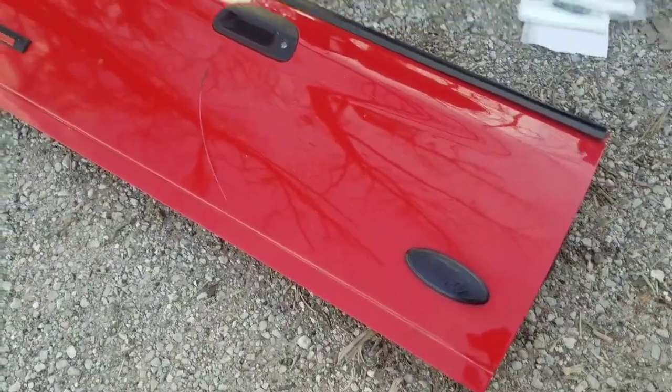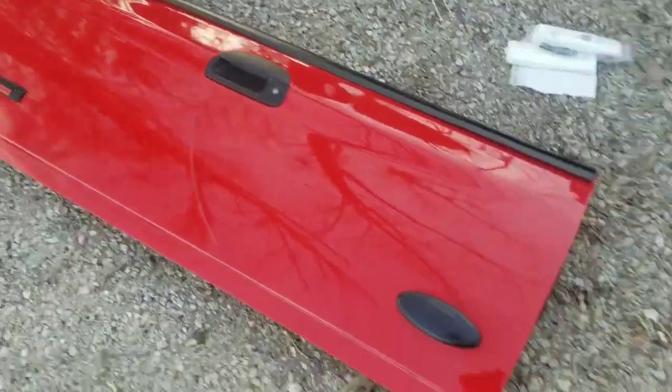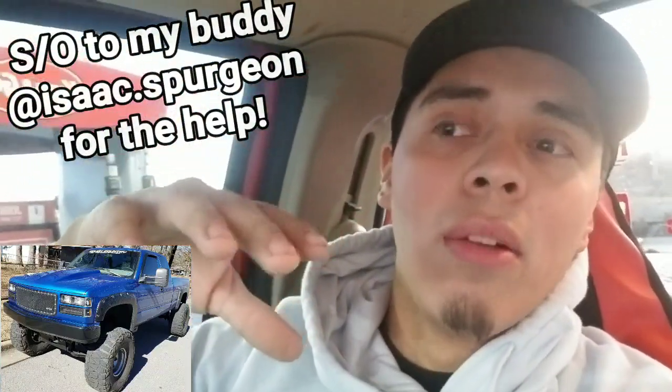No way — I literally just put that thing on. We are headed to LST, we're up at 5 a.m. and we didn't go to bed till like 1 o'clock in the morning. We ran into so many different issues last night — running around putting the decals on. The headlights had a wiring issue: one of the pigtails wasn't working right, the left headlight would go out sometimes while I was driving. The pigtail was so old and worn out from me plugging in different types of headlights throughout the years, so I bought a new pigtail and wired it in. I wired things backwards so I only had my low beams and no high beams.